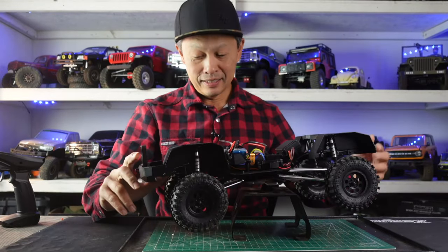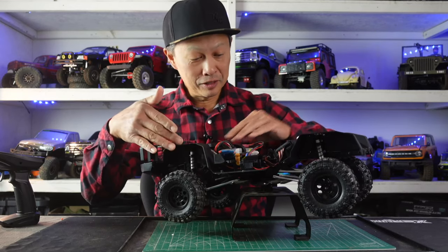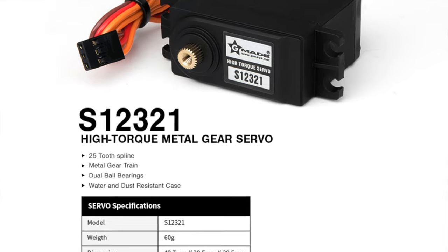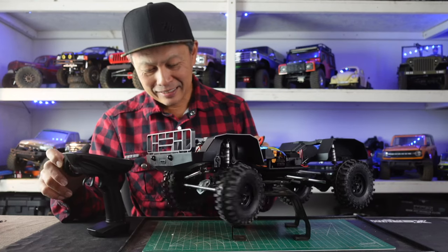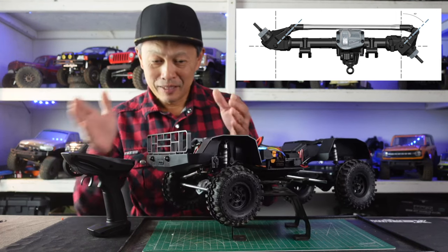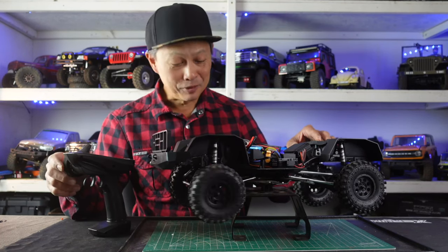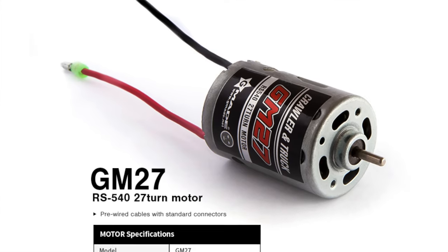The quality is nice and the body is not that heavy. The wheel wells don't completely cover to the body. The steering servo is 13 kg — pretty good — and the steering itself is 45 degrees with what they call zero Ackermann, meaning the angles of the two wheels are correct, giving a tight turning radius. Metal gear servo, not the fastest, but 13 kg seems legit.